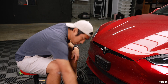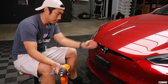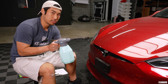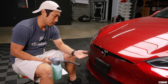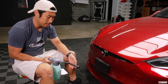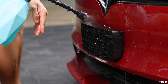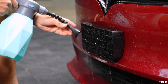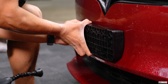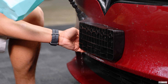What we need to do is heat it. We could actually use a heat gun like this, but part of this is it doesn't really go inside and it's really hard to heat underneath it. So this is a very long process. What I like to do is use very, very hot water — not quite boiling but pretty hot — and just soak this area to heat that side. I have this really cool sprayer and I really try to soak it in that area. Heat is really good because it will loosen up the adhesive a lot better.